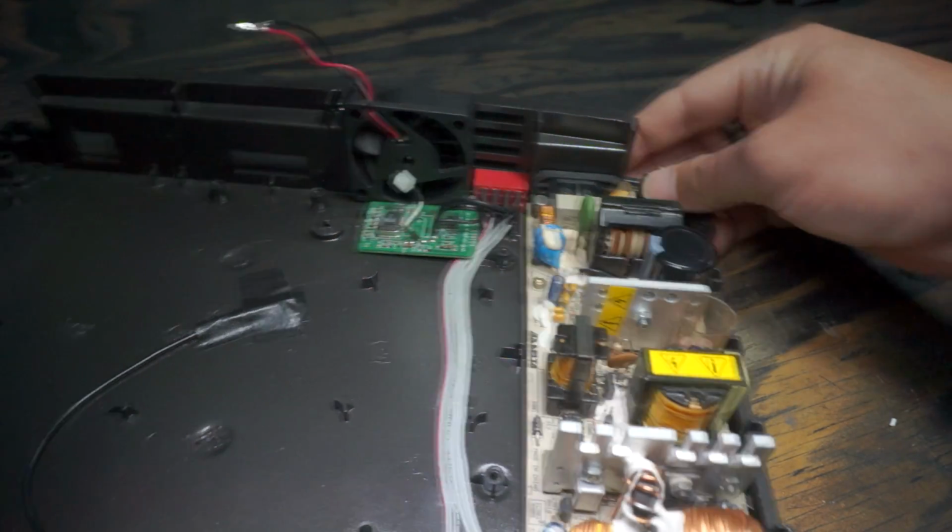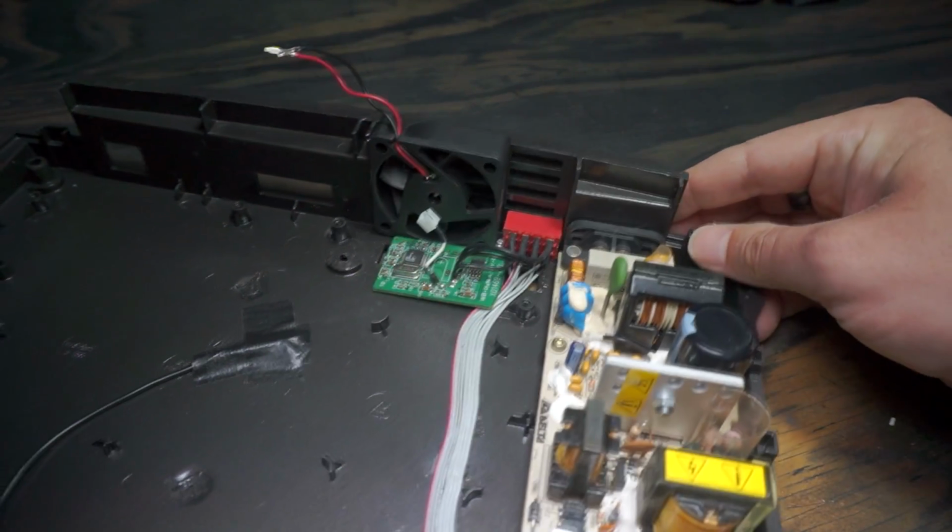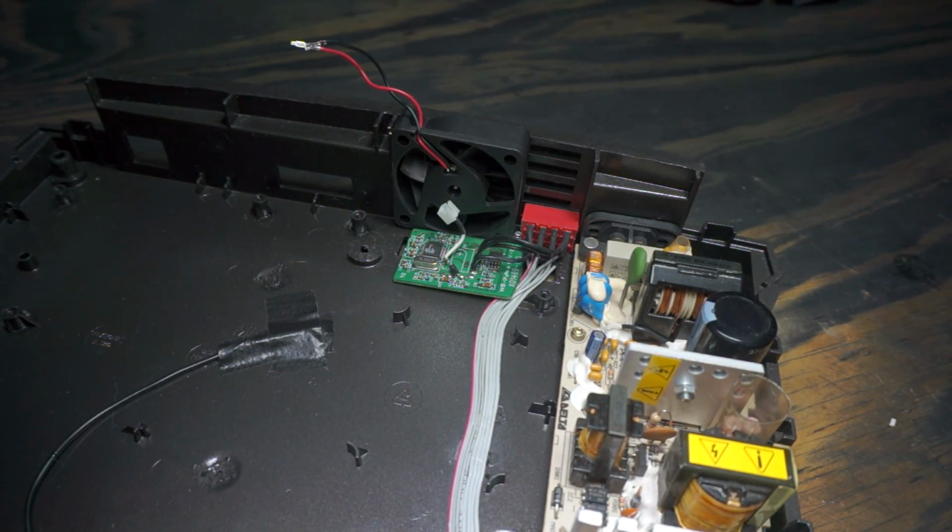I moved my temperature probe underneath the motherboard between the CPU and the GPU. It's just held in place with some electrical tape. The readings seem to be 5 to 10 degrees off most of the time from what my mod chip says. Can't expect it to be all that accurate, but it gives you a rough idea, which is never a bad thing. I originally saw the mod done on a 360, so I did it to my Xbox to add a bit of bling, and now I just can't seem to stop doing it.